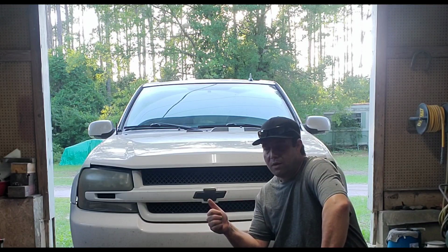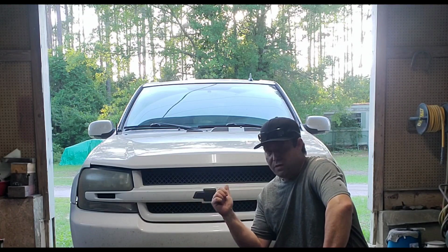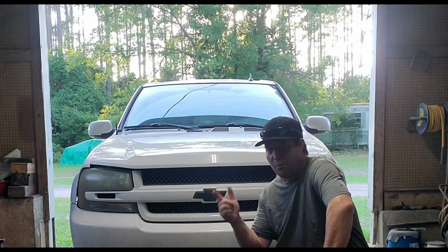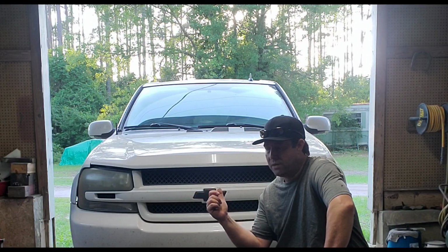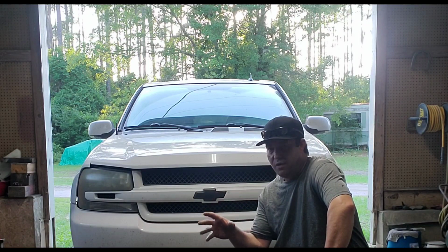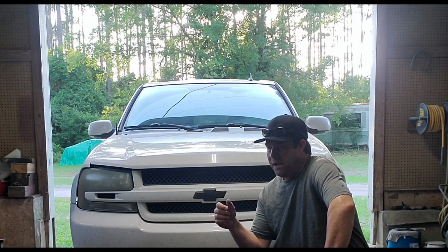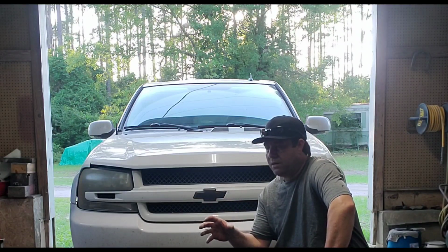So, number one, you're going to want to know what type of oil you need. In my case, I use 5W30 full synthetic, and you want to know how much oil your engine takes. So mine takes 6 quarts. I usually buy a 5-quart jug and then a quart of heavy duty oil stabilizer, usually Lucas or Hyperlube. And then you want to know what type of filter you need for your specific model.